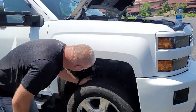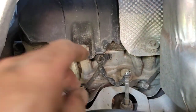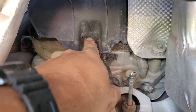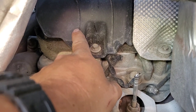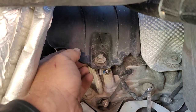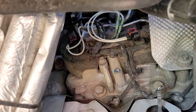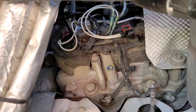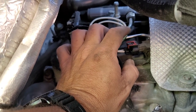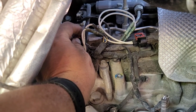The next thing I'm going to do: there's a 10mm bolt right here that takes this plastic cover off. I'm not going to worry about the front side because it stays. Number 7 is the very back injector on the passenger side. So we're going to pull this bolt out and get this plastic cover off — that's the only thing that holds it. You can lift this up; this is the same way you go in to do the injector connector, and you just wiggle this and it'll pop right out. You can see my number 5 and number 7 replacement injector connectors right there. The little clips are a pain — they will break, so I'm going to put the camera down and use both hands. This back one is number 7.